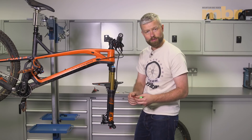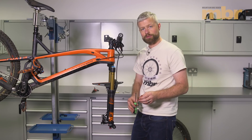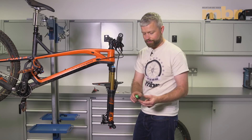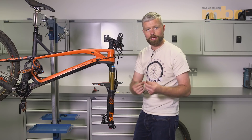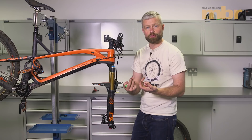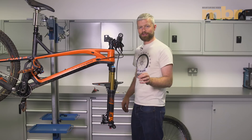With these SRAM brakes, once we've fitted our new pads, we're going to use this pad spacer — push it in between the pads, and it will set the correct spacing ready for the rotor to go in there, and hopefully we'll have no rubbing. If you've got different brakes or you don't have one of these, then the best thing to do before you take your pads out is to use a flat-bladed screwdriver and lever in between the pads to push them back, effectively pushing the pistons of the caliper back into their bores, and that will reset the brake and give you plenty of room for the new pads. The pad spacer is the better way to do it, though, so if you've got one, that's preferable.